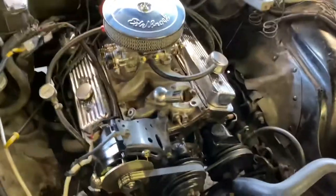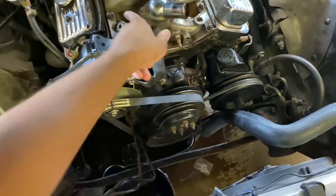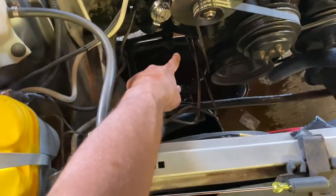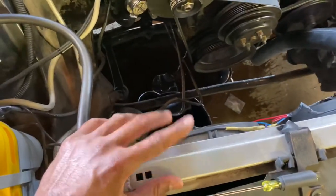So check it out. I'm about to hook up my water hose to the upper housing here, flush it out. It's going to flush out what's all in the engine. I'm going to flush it until it goes clear — I'm going to be good on that side. Then I got to flush my radiator until it's clear. That's next.